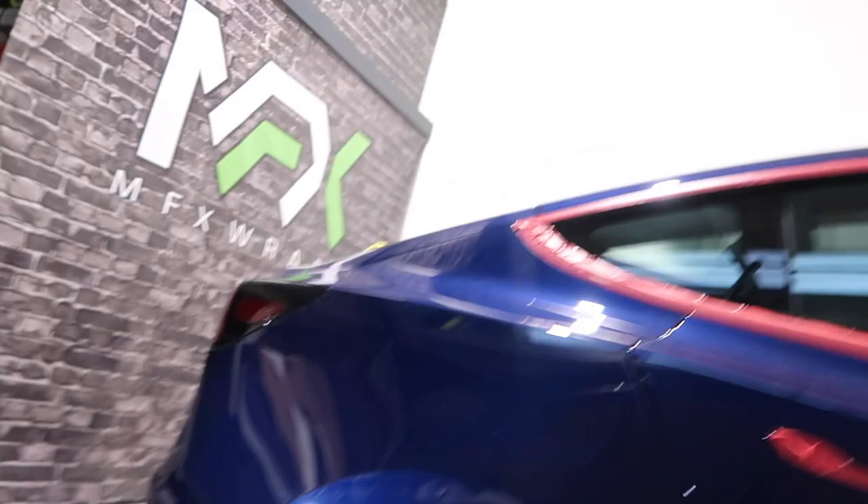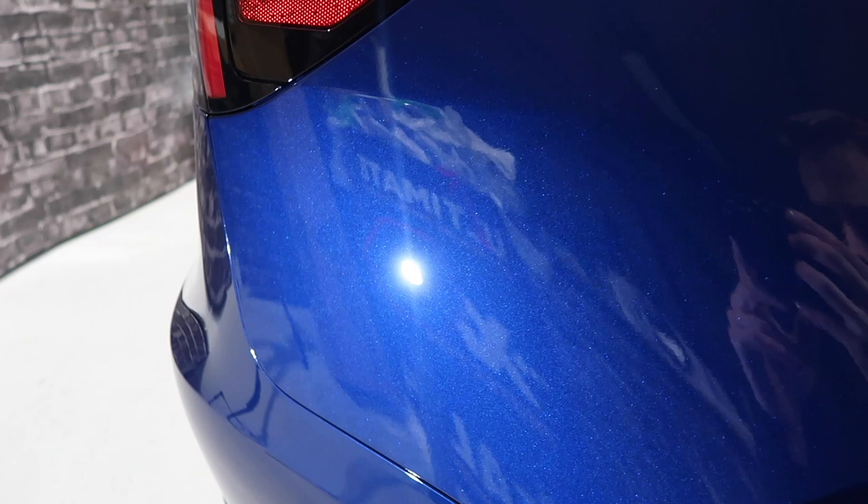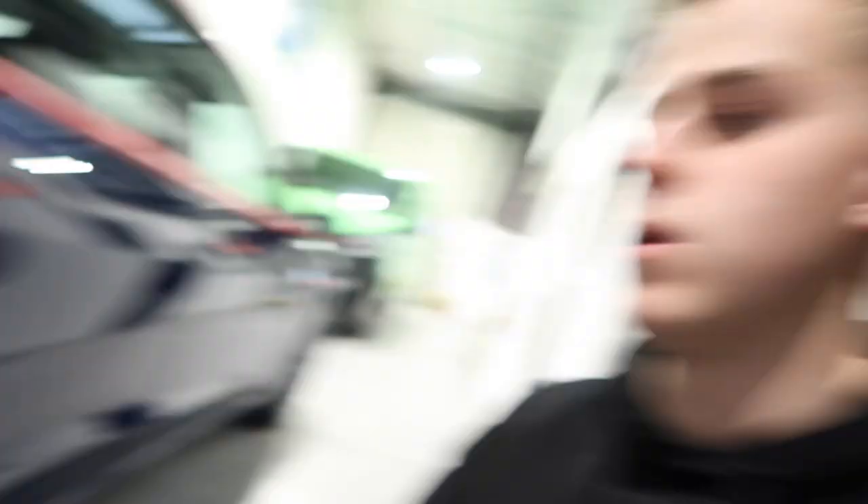Let me give you an example. Here's an area that I've cut — it looks very bloomy around the light. So let's quickly do one of those fancy transitions and show you the difference. There we go — the refined version. Trying to get nice and close so you can see the flake. Very difficult for the camera to focus because there are no scratches to focus on. But as you can see, that's a much more glossy finish — basically removing all the tiny scratches put in when removing the larger scratches. Then just a straight single stage over the rest of the areas like the pillars.